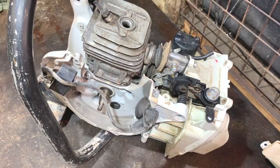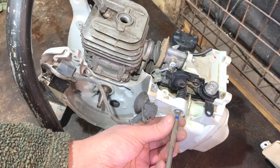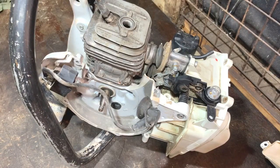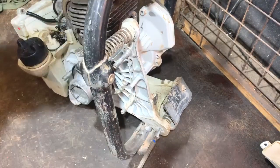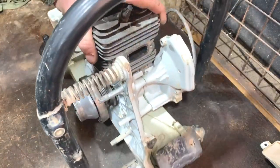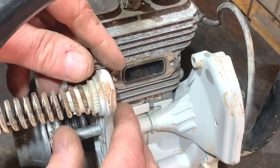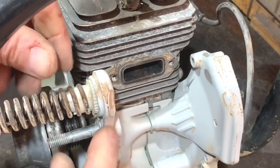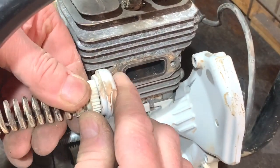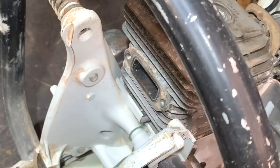The three carburettor bolts are in now, so that's holding everything together along the top end. I've now located the anti-vibration springs so I just have three bolts to go in them — I'm putting them in loosely at the moment so everything falls into place. There are two around the other side. Then we have one more on top — it's like a little cog really. That just fits into some cutouts in there, so it locates in there like so, and then a bolt just goes through from this side to hold it all together.